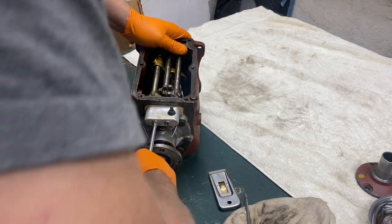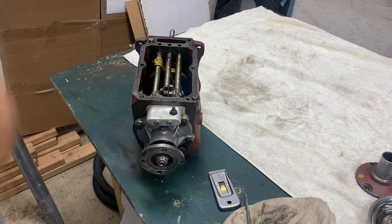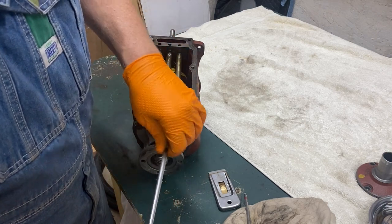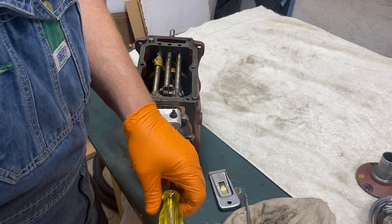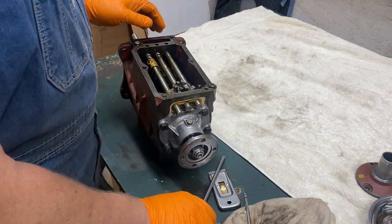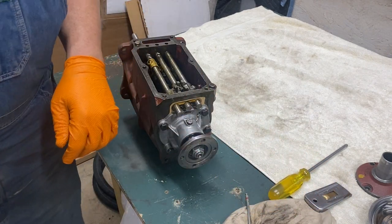These are a much larger Phillips screw than I had thought. I just grabbed a number two. I've been having some health problems lately — getting pretty severe arthritis in my hands. I can't remember what this kind of screwdriver is called; it's just a big Phillips with a blunt tip. You can tell me in the comments what it's called — we use it in the ski industry too. Perfect for those screws — takes them right off. That's the housing for our little reverse switch, which gives room for the selectors to move in and out. I pushed on the number four — I think that's the three-four selector — and nothing happened. It doesn't move, and that's the problem I ended up with when I got the transmission back together.